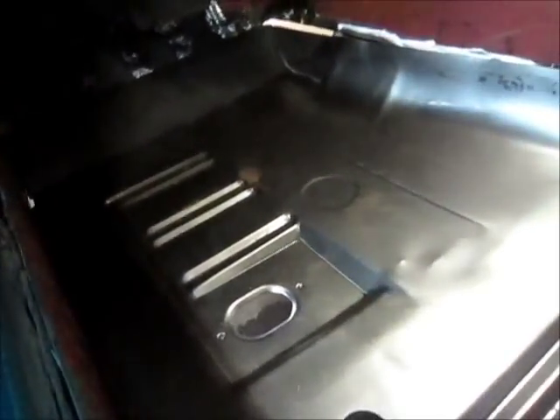Now, this isn't exactly where it's going to fit — I'm going to have to move it around some. But a couple of things I wanted to show you: when I took the old one out, I had marked marks on the inner rocker panel. You can see them there — here's the black marks. When I had this thing set in the right spot, I re-marked this sheet metal, and that gives me a point where I can drill a hole and I know it'll line back up with the original spot welds. Not that big a deal, but if I've already got bare metal, I might as well connect back to it.